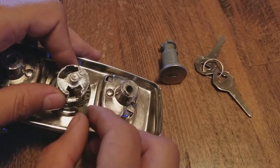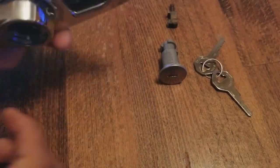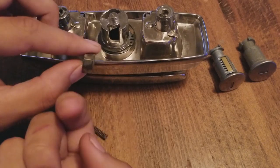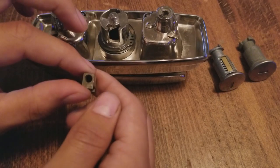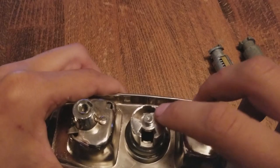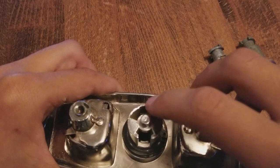Setting the old cylinder aside and flipping this over, your pawl and spring can be removed. The pawl has a smooth side — this is going to face out towards you relative to that rectangular notch. There is also a hole in the back; that is where you put your spring. There is a recessed keyway of sorts, and that's where the spring is going to sit.